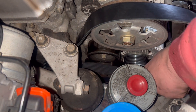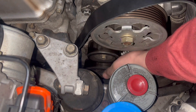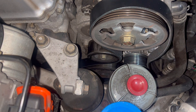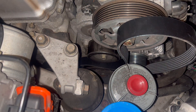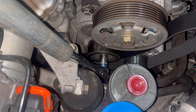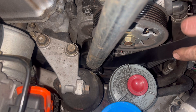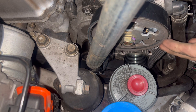This side of the belt goes underneath the alternator — go ahead and push it through there. Put it back in that pulley, going underneath. On the alternator, this one also goes underneath the pulley, which is the tensioner. Make sure while you do this you put the belt under that pulley — the tensioner — because once you have the socket on you won't be able to do that. Then throw the belt over this wheel, making sure it's on the tensioner.